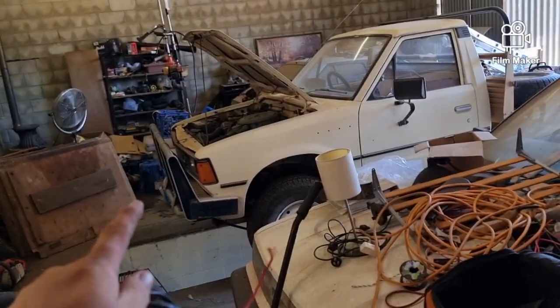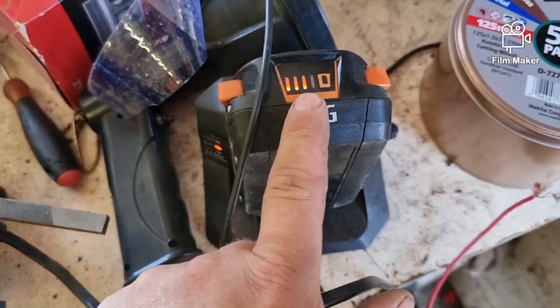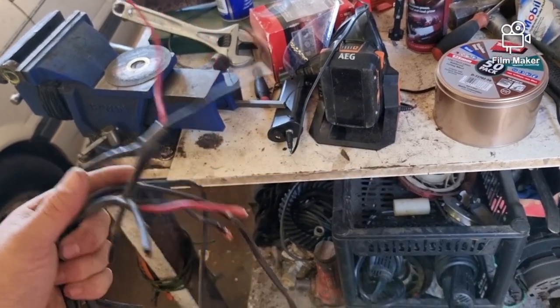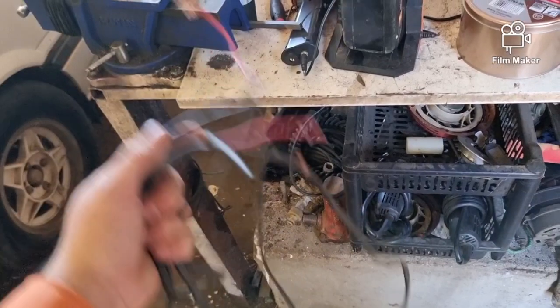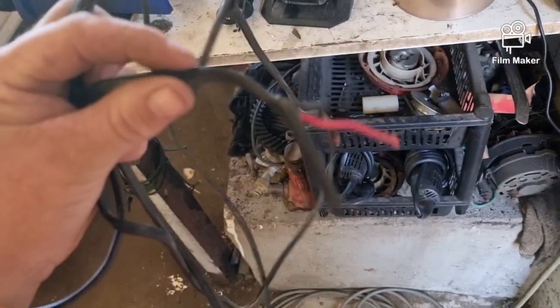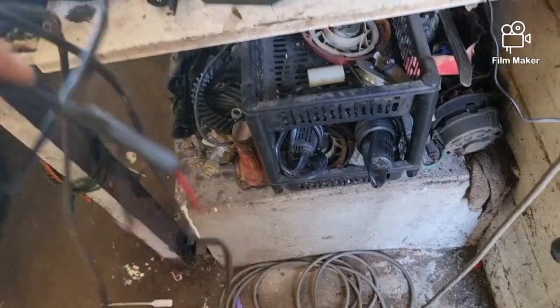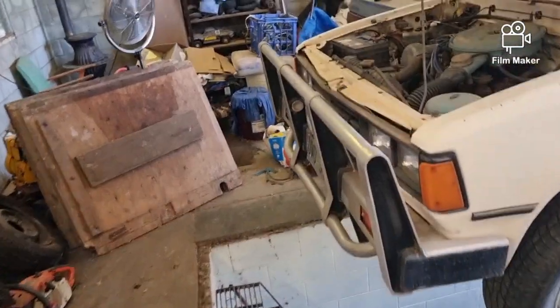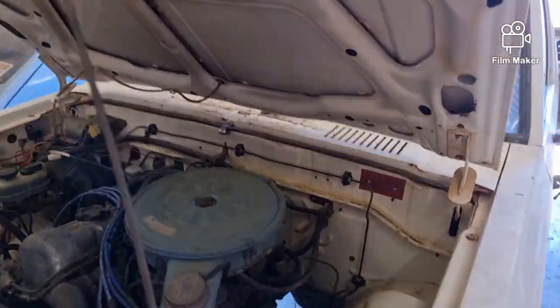I got fuel in the 720 and that battery wasn't quite good enough to start the thing, so I just used two cells out of this battery and held this in the cab whilst the other end was hooked into the battery leads. That end there actually got quite hot and I almost burned a finger, but I got it running so now I can move this thing out of here.